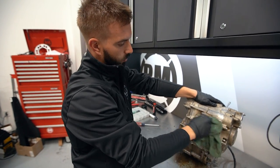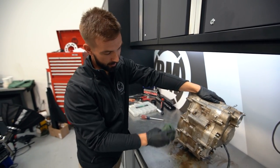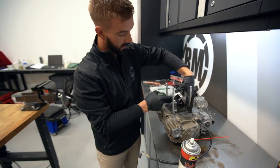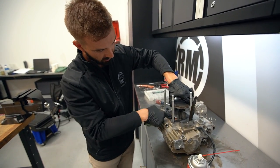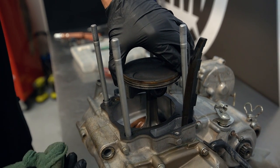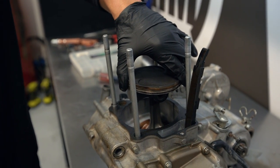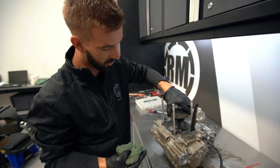The update is we have the motor pulled. Piston and crank are bad. Right now I'm actually just cleaning up the motor, getting it ready to pull apart and split the cases. If you ever pull a motor apart and look at your top end — you've got your piston and your connecting rod — if you have up and down play, you'll be able to feel it. That means your bearings are worn and you really need to replace your bottom end before you risk doing some serious damage.